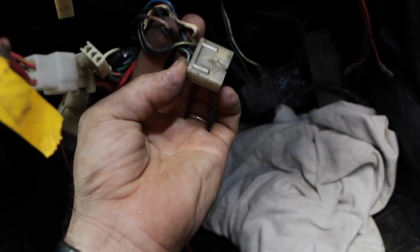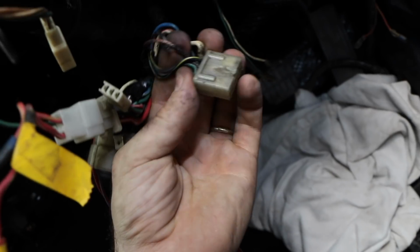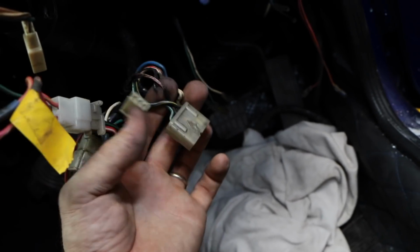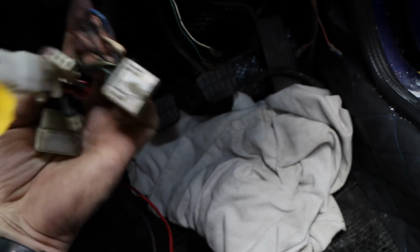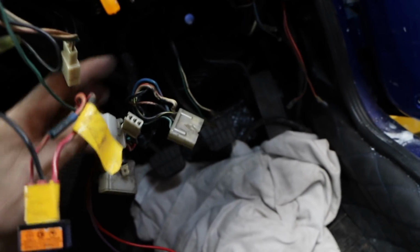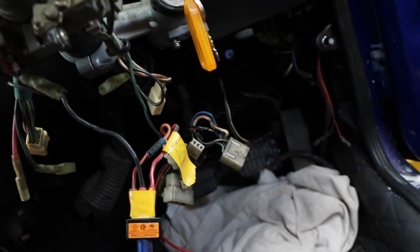I've got to go through now, and I'm going to disconnect this, and I'm not going to strip it out of the loom. I'm just checking the wires. I followed it a fair way back, and I'll follow it up a little bit to make sure it hasn't cooked any other wires, but I don't think so. I'm going to just disconnect it and run a completely new wire to follow that circuit, so hopefully I can actually get it all going again.